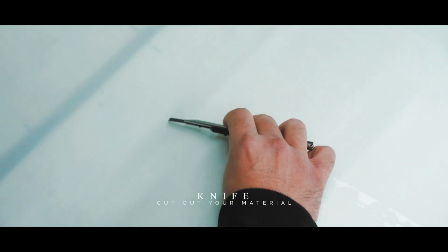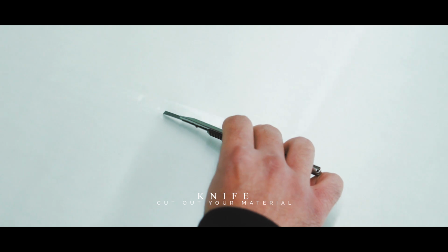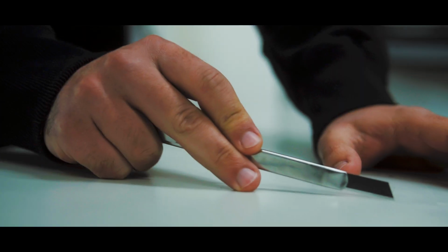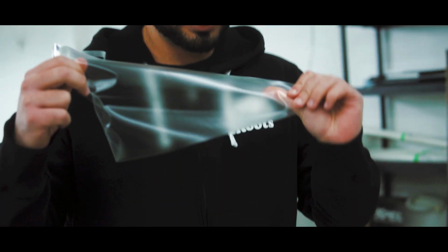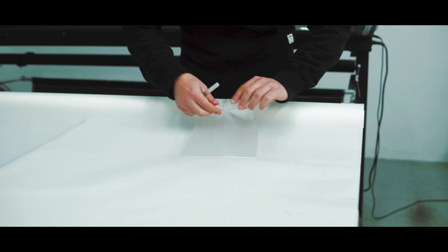After the pattern is cut out, I like to remove the excess material and the dead space. It is inevitable to have large areas of dead space, but you can separate it and use it for custom work later. Stealth looks translucent on its own, but once it is applied, it is totally clear. It will not hide the color at all.